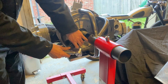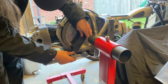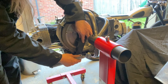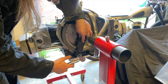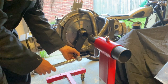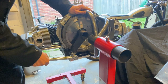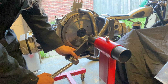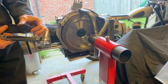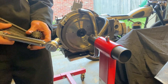So here goes, let's see if this works. I'm pretty experienced with this tool so I knew whether it was going to work or not straight away. It's slipping — that's what it did before. So it could be this gear here. I have a brand new one of these gears so I'm going to take this gear off and put the new one on and see if that works.